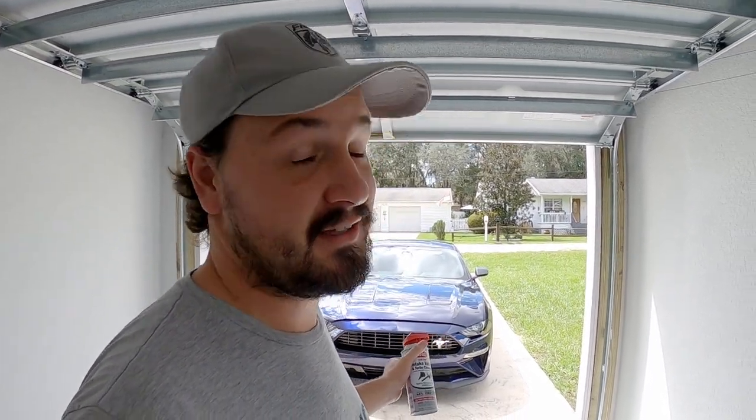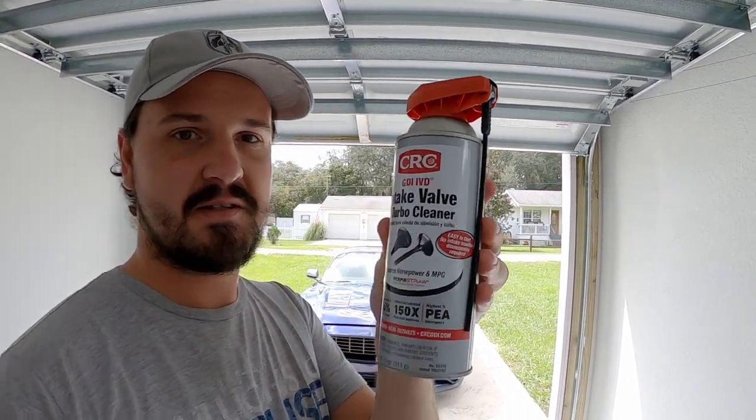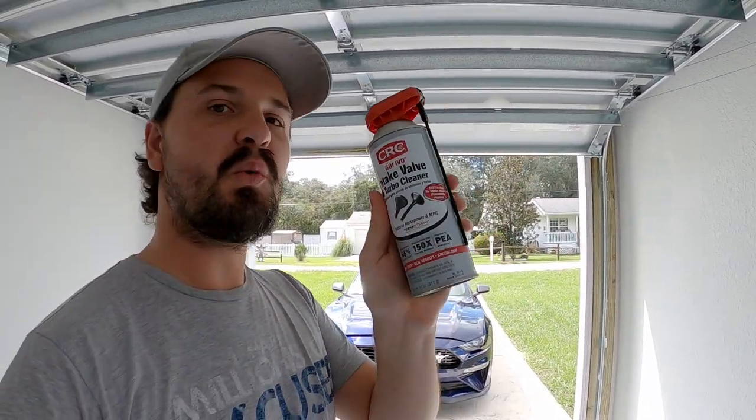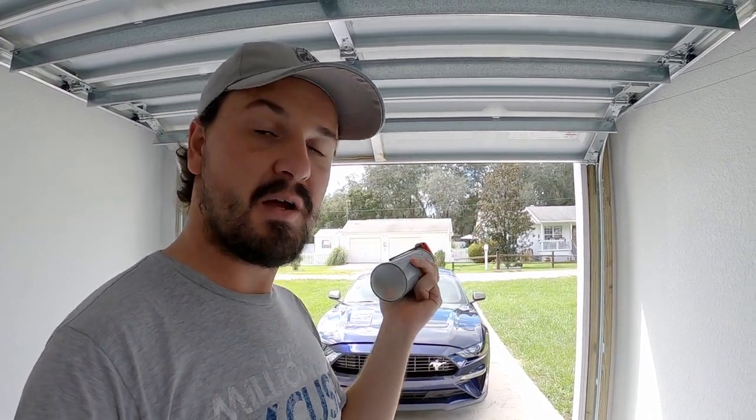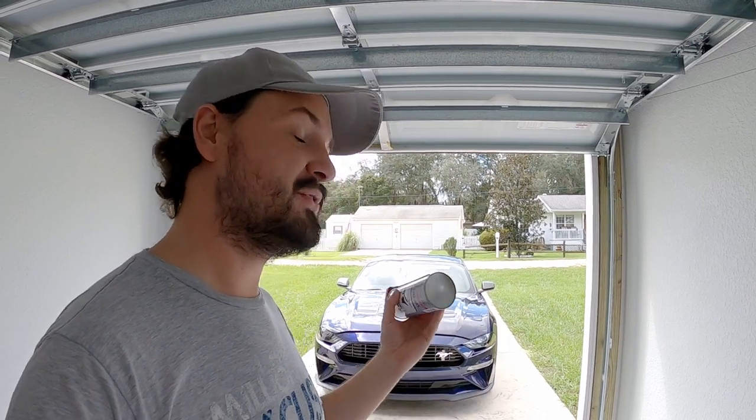In this video I'm going to be doing a little bit of maintenance on the Mustang. Modern Mustangs, except the Coyote of course, are direct-injected, and one of the problems is stuff building up on the backs of the valves because there's no port injection to clean them. Thankfully there are products on the market such as this one that generally work pretty well in keeping up with the problematic GDI systems on these newer cars.